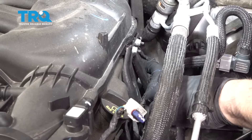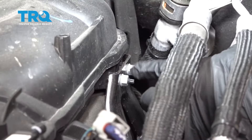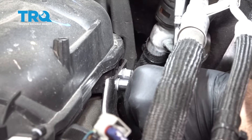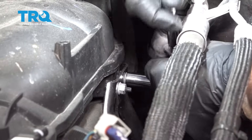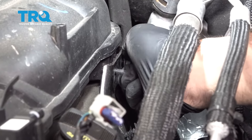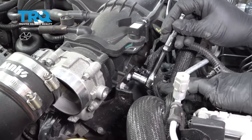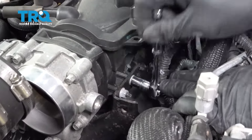While that's actually your vacuum tubes — go ahead and pull that aside. On the driver's side rear, you're going to find two 10-millimeter nuts — go ahead and remove these. On the front side by the throttle body, you're going to find two more 10-millimeter nuts. Remove these.